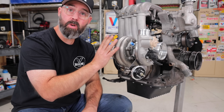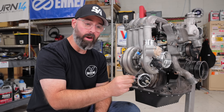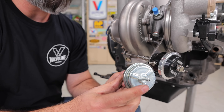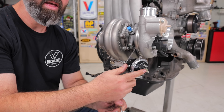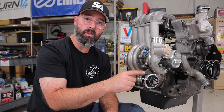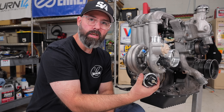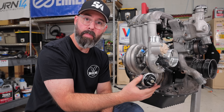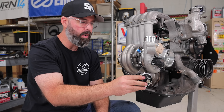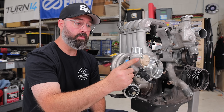One upgrade recommended by Elliott from Turbosource was this Gen 5 TurboSmart actuator for the internal wastegate. The factory unit is physically smaller with a single port, while this is a true two-port unit — giving a much broader window of boost control. It has a collar system to change the internal spring from 5 psi up to 26 psi, and a larger internal diaphragm surface area for better boost control. We're also upgrading to TurboSmart's internal blow-off valve, which you'll see in the build series.